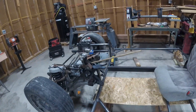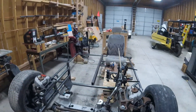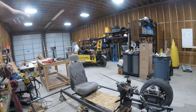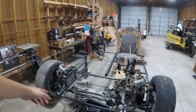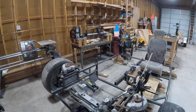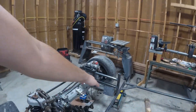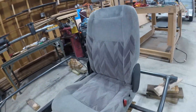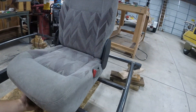We're going to cut this video right here. We have quite a bit done. In the next video, we're going to work on adding the roll bar on the back as well as finishing the main cage of the vehicle. But in this one, we got a front sway bar mounted. We pretty much got the entire frame built, actually. We have suspension mounted, a seat mounted — the seat actually moves, which is one of my favorite features. So the seat's adjustable for different height drivers.